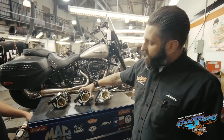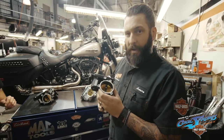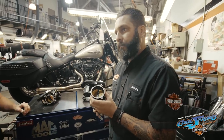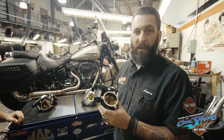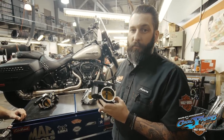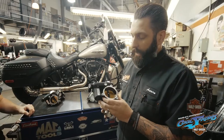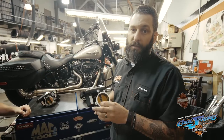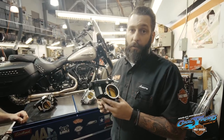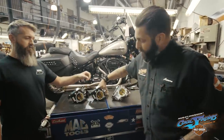Parts matching is a critical component in producing big power, and our focus here is matching parts carefully to produce power for our customers. The application for the Stage 4 throttle body is going to be for your customer that has either a little bit bigger cam, a little bit more displacement — 117 cubic inch — or a high compression 114 with a big cam. A lot of guys try to throw a lot of throttle body at it; I don't think that's a good idea. Maximizing flow, maximizing velocity in the intake is important. That's where HPI comes in.